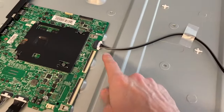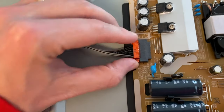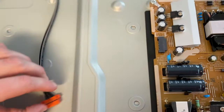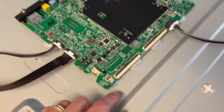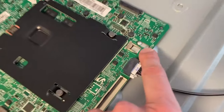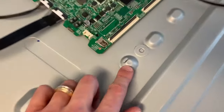Back to your main board — in most cases this connection point is more stubborn, so we're going to remove it from the main power board. The 12 is on top — pinch the outer edges and shift this connection apart. As for removing the main board, you have spring-loaded tabs on the underside. Carefully lift it up over that little tab and shift it forward — it comes out of the little slots.